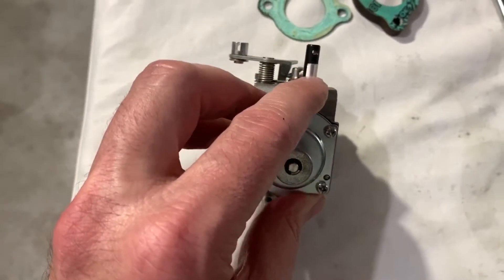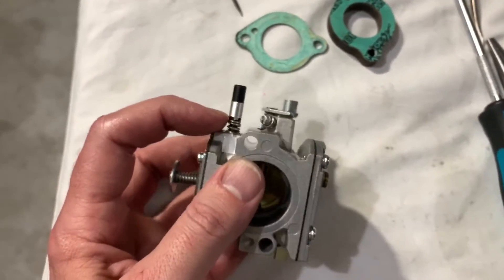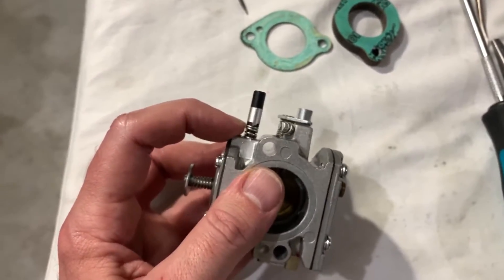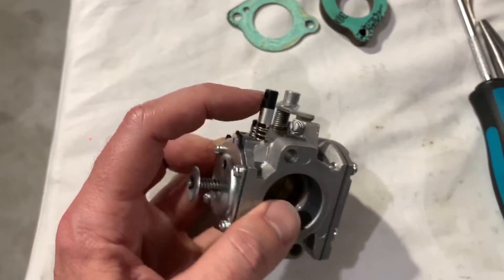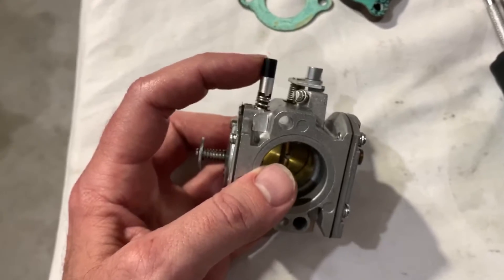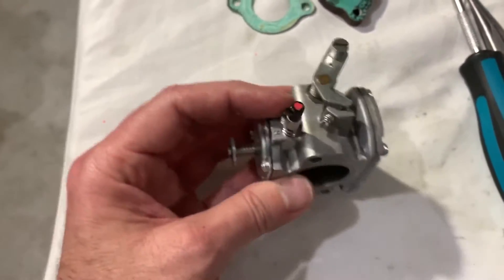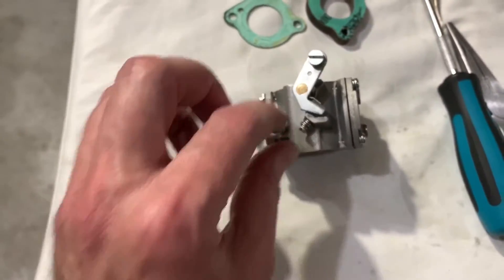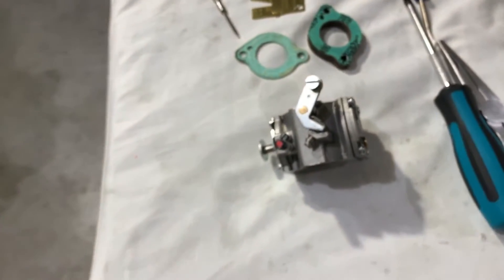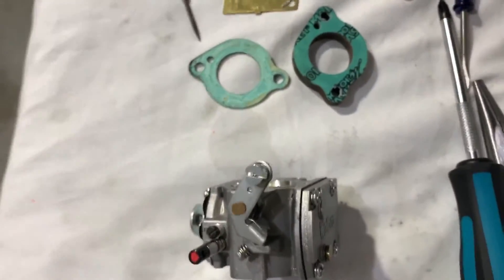The piece is back together and the jets are back in. Remember on the hi jet there is an o-ring and a washer underneath there. I broke my seal — going to hell — but the warranty's long gone. They both lined up; I took a picture of them before I took them out and I seated them just to count how many turns they were in. It all came back to what the manual says.